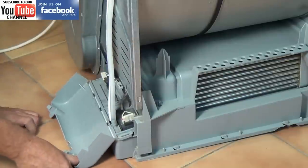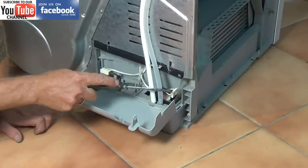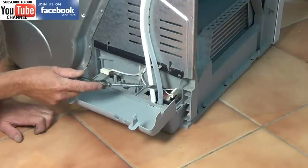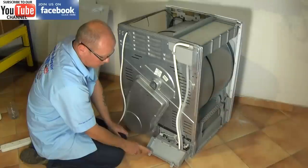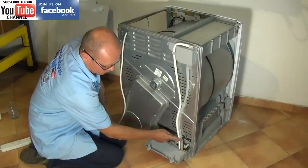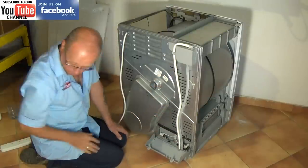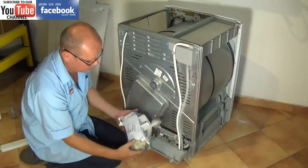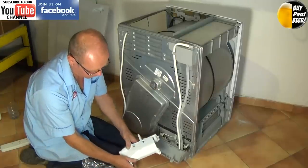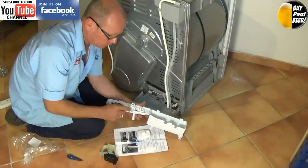This exposes the pump to the right hand side and you've got a micro switch on the left hand side which connects to a float underneath. The water that builds up in the bottom goes up the white tube to the collection tray at the top. If the tray at the top overfills, the water comes down the clear pipe back into the collection tray and then is pumped back to the top. But if the pump runs for too long or isn't able to pump the water out, the machine program will time out and come up with the error fault.